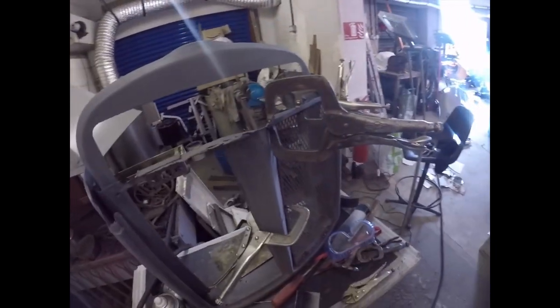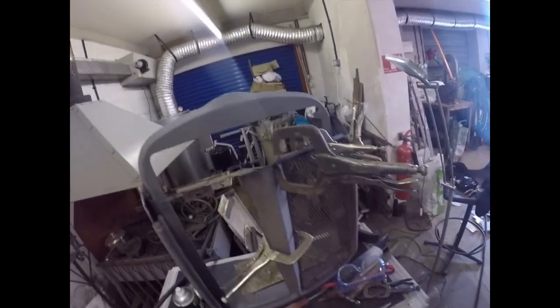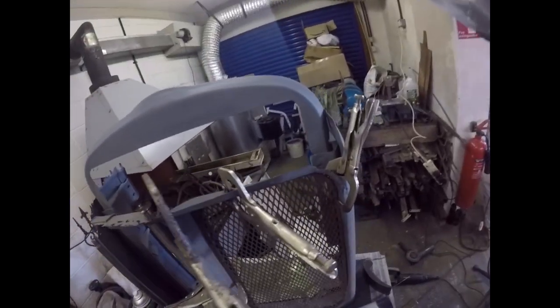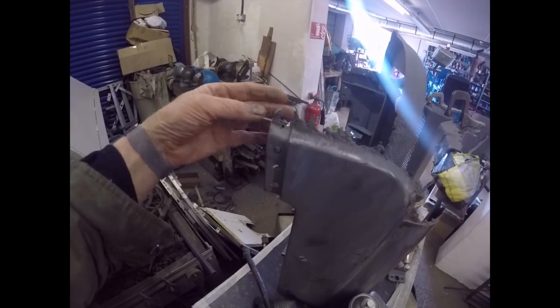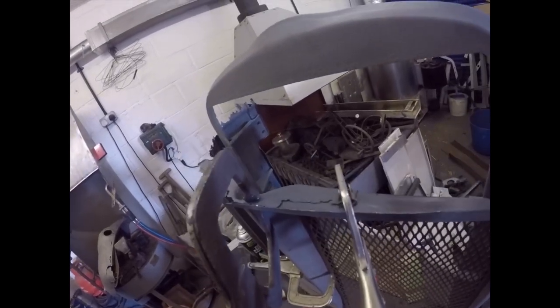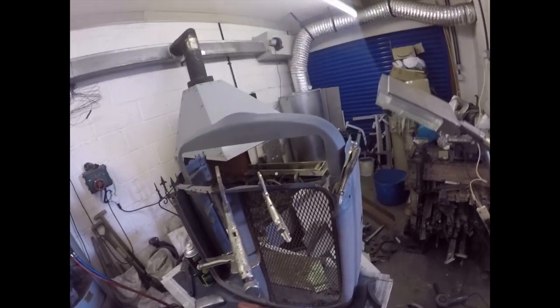Good morning, it's Tuesday. I put some of that gray primer which advertises itself as weld-through on last night, so I'm ready to weld this piece on. The great advantage of making this bit is now I know what I want for this side, so I can make a piece to match. I ran out of TIG gas and have had to do it with MIG, but you can get neat little spot welds with MIG and then grind them down — absolutely fine.